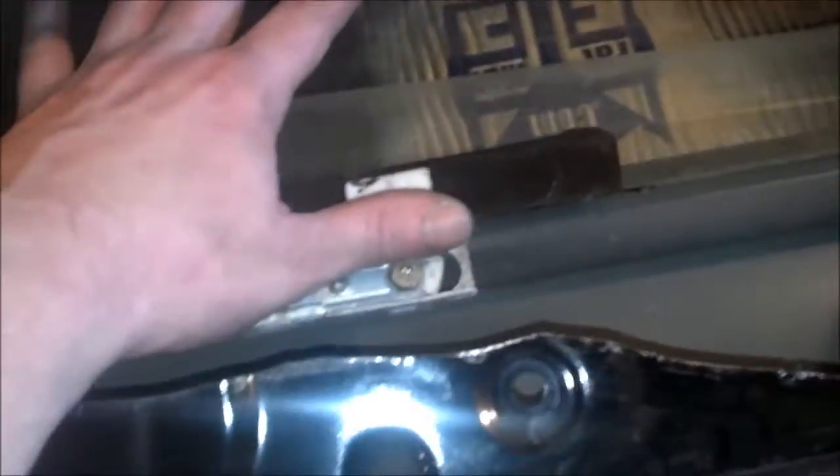So now I'll start by putting a piece of cardboard down, and then building it out around, making a framework, so that the fiberglass can't drop below the point of the metal, or above the point of the metal or anything like that, so it can slide in and out, and also to hold it away a little bit from the edge.